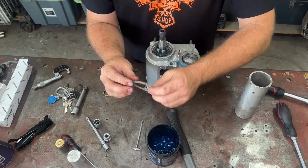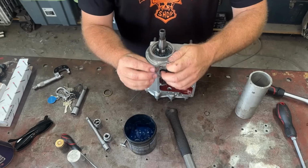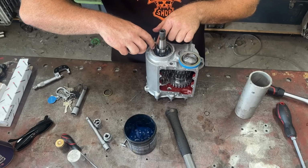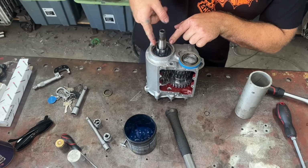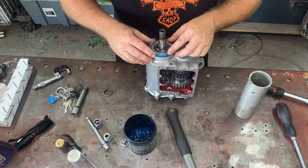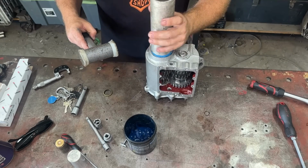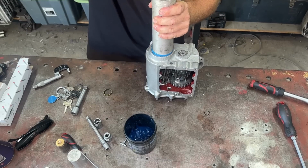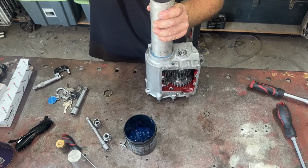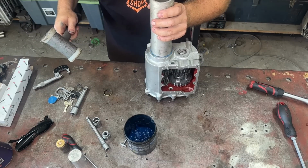This is the little cork gasket that's supposed to stop the oil from going around that main seal out the sides. So this is meant to crush in there. Doesn't really do much, but let's just put it in there because it's supposed to be there. Doesn't mean it freaking works. So that in there, and then we put this down, and you see that goes over there now. We don't have to worry about trying to seat our seal nicely on that. So just get our little doodad here. Right, that is freaking home.